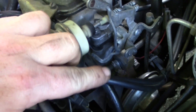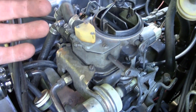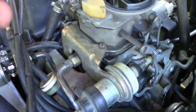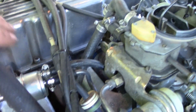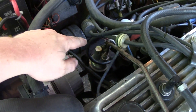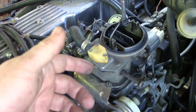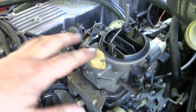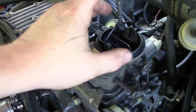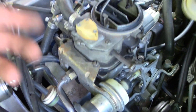The same could happen for the carburetor. Even though at the bottom there is a plastic spacer used to insulate the carburetor to a degree, even this is hot to the touch just because it's under the hood in the engine bay. Everything is going to boil gas. In a vehicle which has no way to control vapor lock, vapor forms in all of the lines and displaces the gas. On some fuel pumps it'll actually force the gas backwards all the way back to the tank. It can also force gas forwards into the carburetor, where it continues to boil, forcing gas out of the jets and all of the circuits inside of the carburetor, and vapor expands to displace all of that gas.